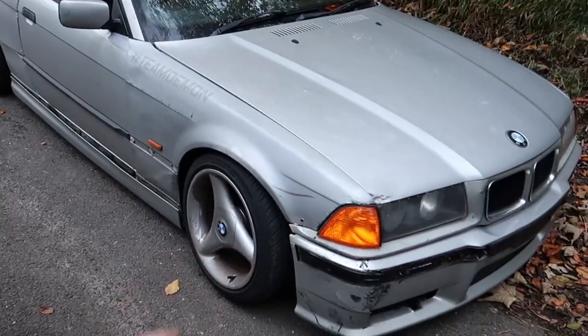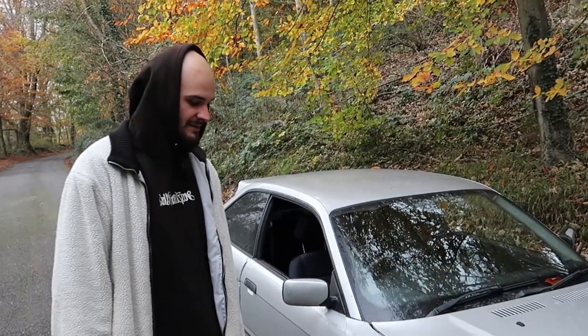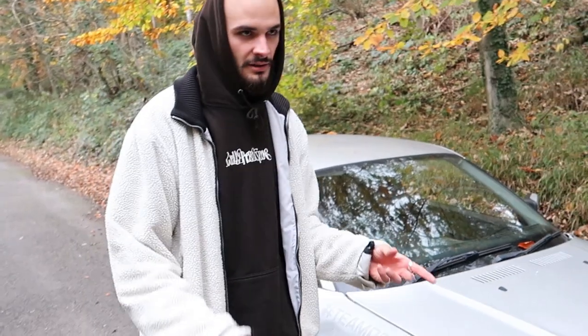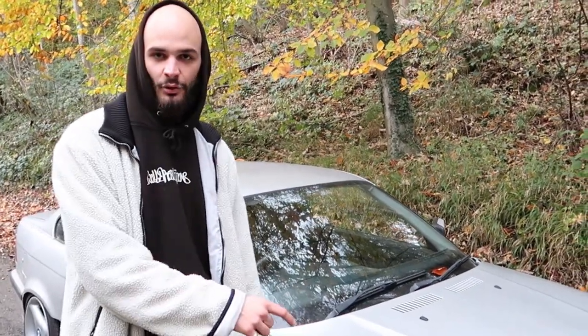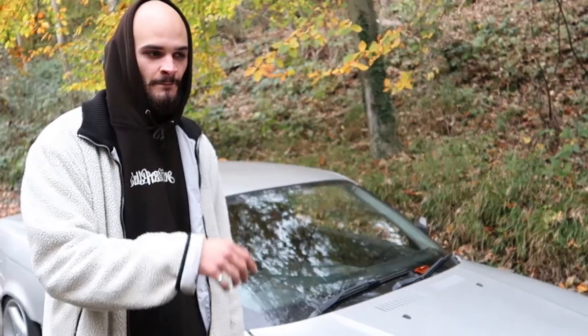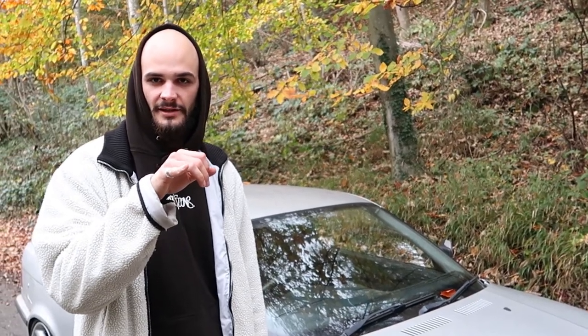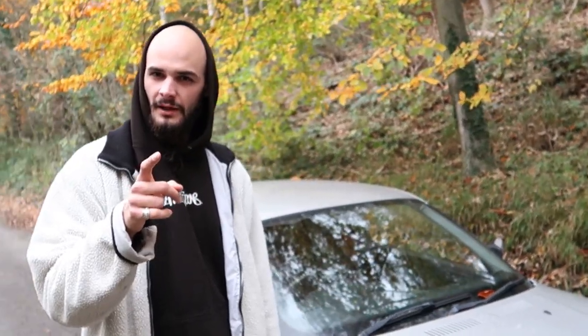That's sick. What steering stuff are you running on this? Is it stock or you got stuff changed on it for more angle? Yeah, so this is actually very stock, in fact. It's got stock knuckles, stock hubs. It just has the E36 lower arms. That's it. They're like 25mm extended, I think, aren't they? Like, I think that's what it is. I think this is what we discovered on that. No, I think maybe it was 20. Was it? Yeah, it's around there.